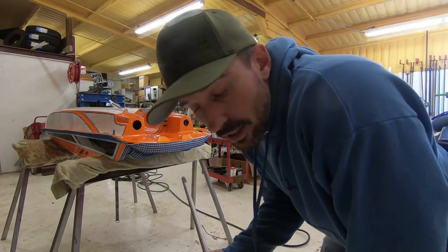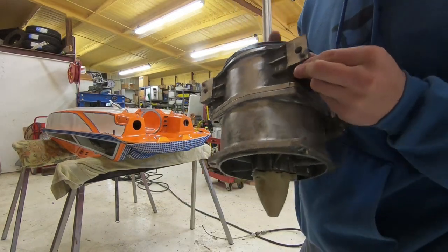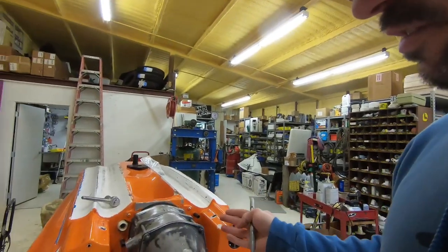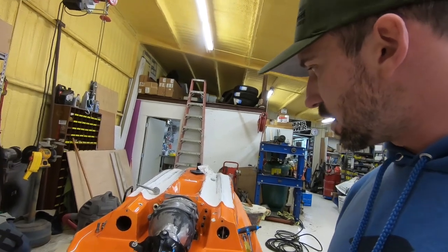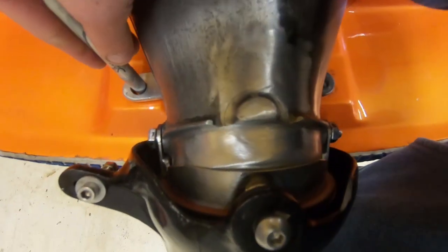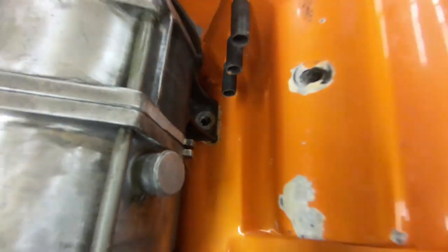So this 155 — didn't know, but the Chan doesn't take dowel pins. I gotta yank these dowel pins out because there's no spots in the tray for them. Some of the struggles with owning an aftermarket ski is it's not all straight — some human being laid this up in a mold, laid up some glass, measured everything, and everything's not going to be perfectly straight. Three holes line up but this fourth one doesn't line up at all. I'm gonna mark it, get the Dremel, Dremel out that side, and check it.